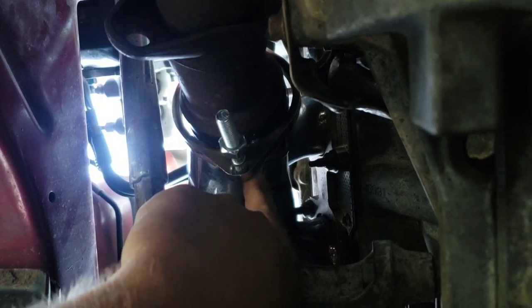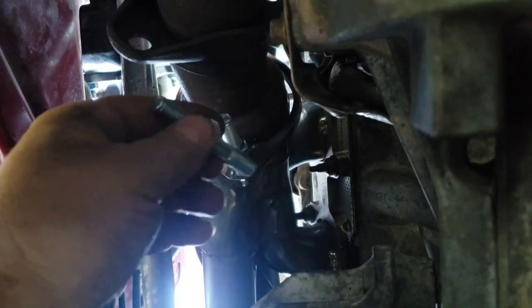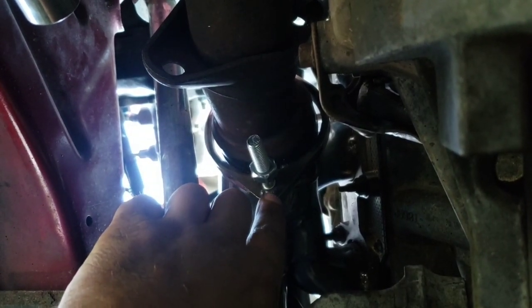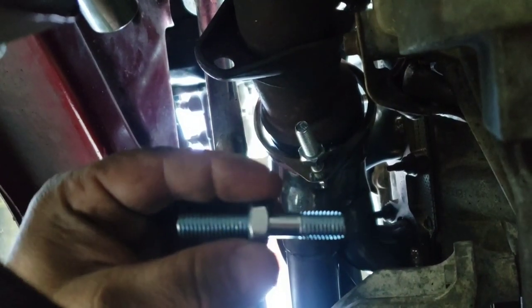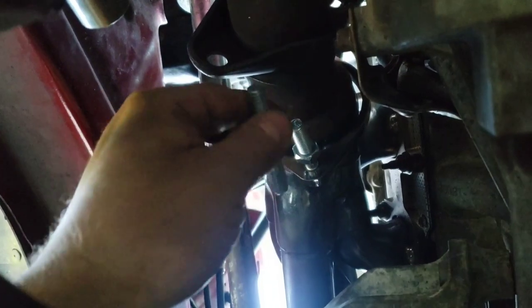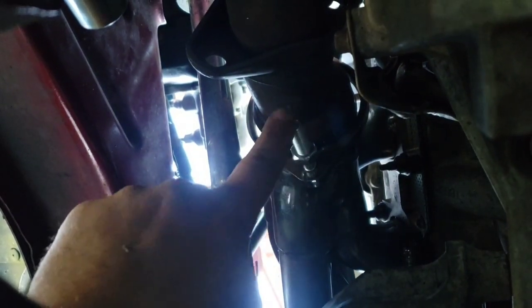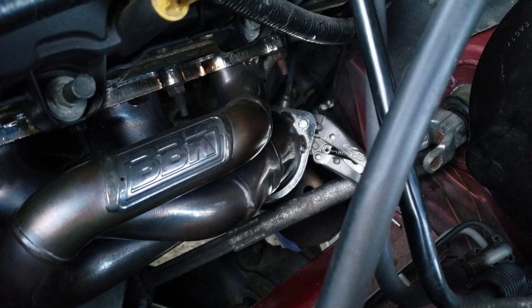I've got it currently sticking out, I don't know, 4 or 5 millimeters on the back. Also, don't forget, you should stick these through that slide flange. You need to slide that flange up and stick them through there first and then start them. Also, one side has more threads than the other. The short threaded side is what goes up into the header, so you want the long section of thread pointing towards the ground. Alright, this is the kind of shit people are talking about with their crappy hardware.